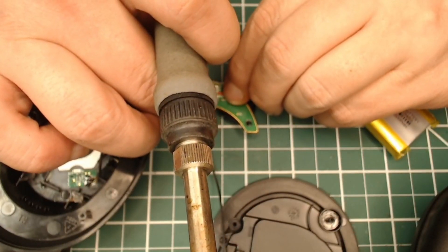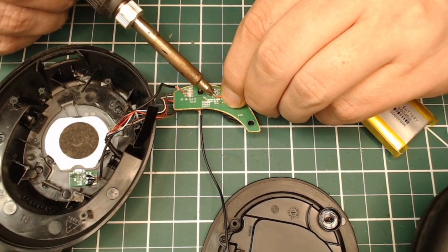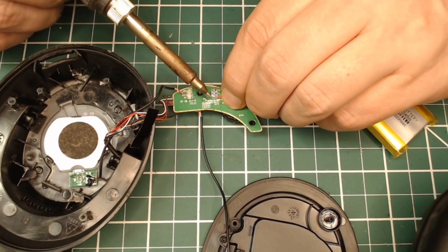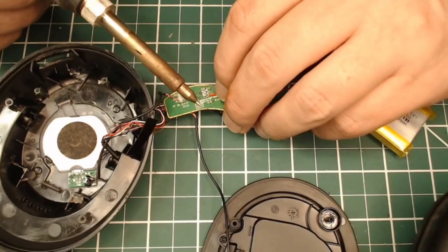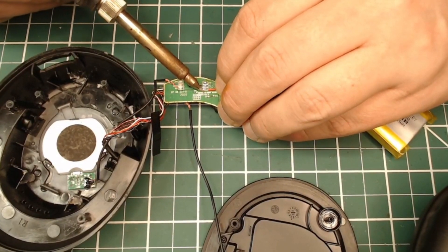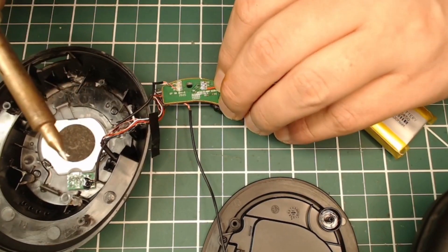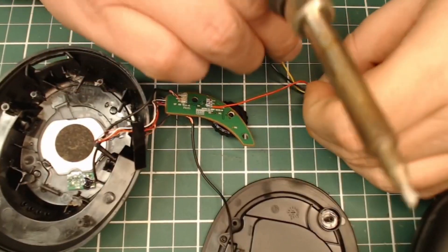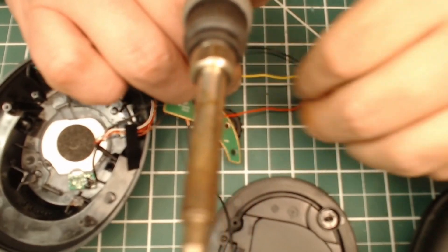The thermistor is just a safety device that protects against overcharge, overcurrent, and overheating especially. So if you're charging your battery really fast and it overheats and there might be some kind of thermal runaway, it stops the power from going to recharge the battery — which is a great safety device that you will find mostly in headphones.